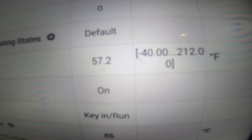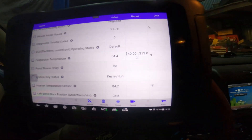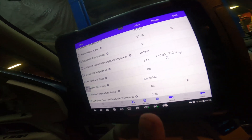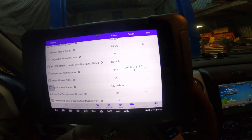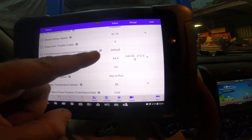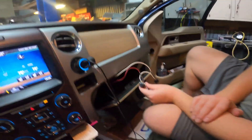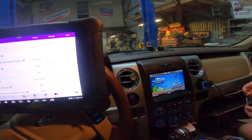We jumped up seven degrees. So let's turn the knob — I can't remember what direction. Just start turning, I'll tell you. So let's tank this up to about 65. A little more to go, a little more to go, right there — back just a hair. All right, we're going to set that right there. That takes us up 14.4 degrees through the resistor. The way this works — you have to drive the truck around. When it sees a crazy increase like that, it doesn't immediately go into effect. You've got to go drive it around and let the truck adapt to it. Once it sees it constantly, it's going to start dropping this back down looking for that 50 number. When it does, we're going to get these temps down into the 40s. So we're going to zip tie these up for now and go for a quick test drive. The more you drive it, the more it gets used to it, the more it's going to push for that to be 50, and the colder it's going to get out of your vents.